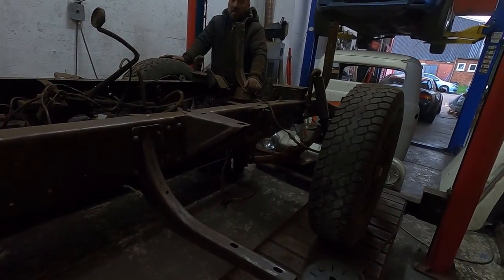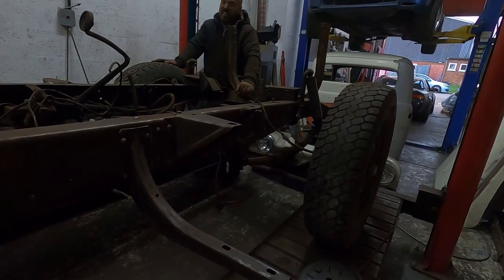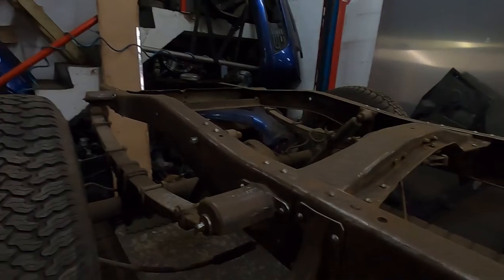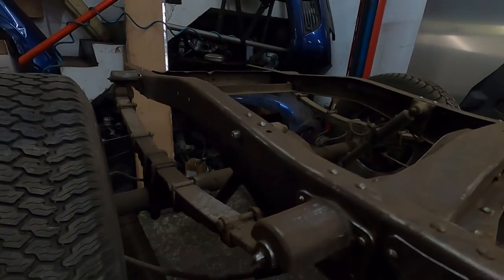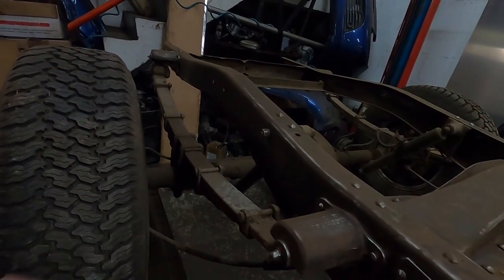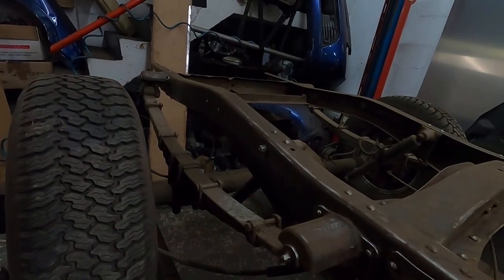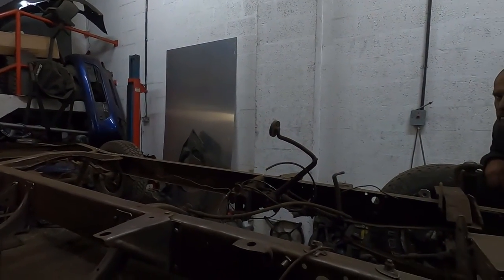The chassis — it's C-section, so it's not even closed. The side walls are fairly thin, so there's not much metal here. Obviously we're gonna get a different front end — it'll weigh a little bit more but not really that much. Leaf springs are heavy, front bars are always heavy. I wouldn't be surprised if the newer front end is not much different — maybe even lighter.